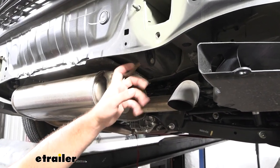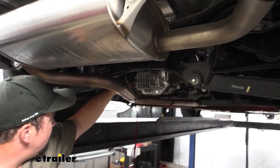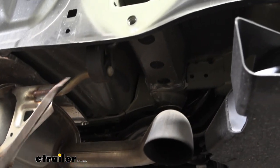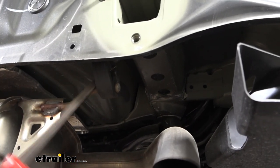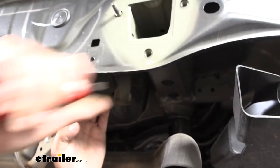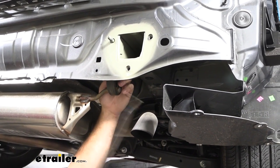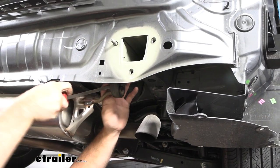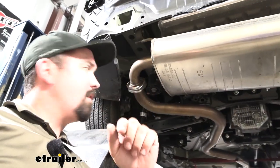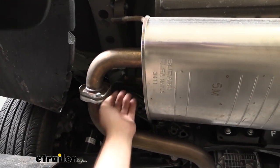There are going to be three isolators that we need to pop off — two at the end here that are nice and easy to get to, and then one right past the rear differential. To get these off, most of the time they're fairly easy: use a long flathead or a pry bar, wedge it in and with some leverage get it to pop off. If it's fighting you at all, you can use a soapy water solution to lube it up a little bit, which will make it pop off easier. There is one more isolator where the exhaust curls back on the driver's side — there's also one on the back side of the muffler, so go ahead and get that one removed as well.